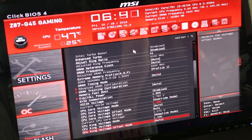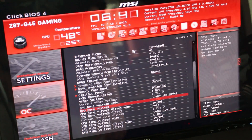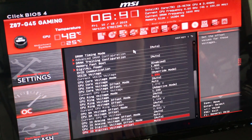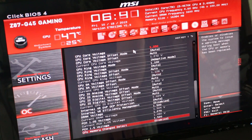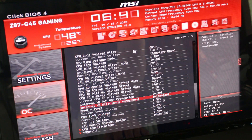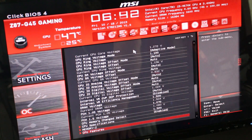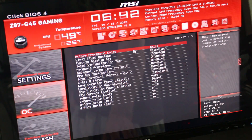The ring ratio is at 4.1 — I like to keep it there, it's a good sweet spot for my CPU. Every CPU will have a ring ratio sweet spot; mine is 4.1. Feel free to copy my settings. The core voltage is 1.39 volts, which is pretty high — I don't like to take it over 1.4 volts personally. I can't afford to risk damaging my chip. For DRAM, it's clocked at 1.5 volts — XMP profiles are fine for Haswell. From my frame latency testing, it loves low CL timings and RAM speed doesn't matter as much on Haswell. I also upped the PCH voltage slightly from 1.05 to 1.07.